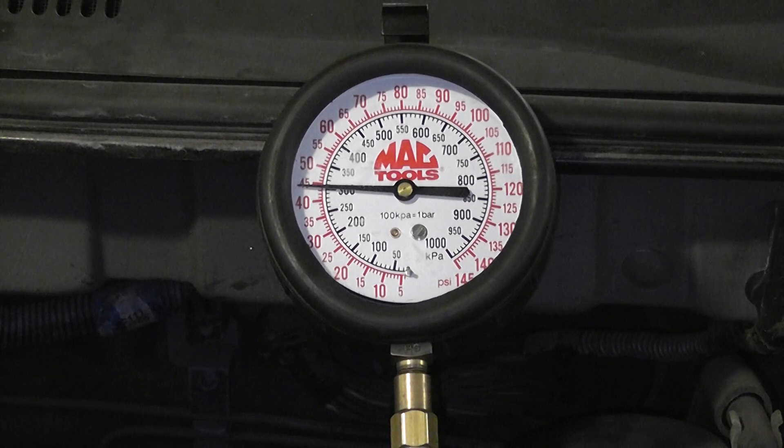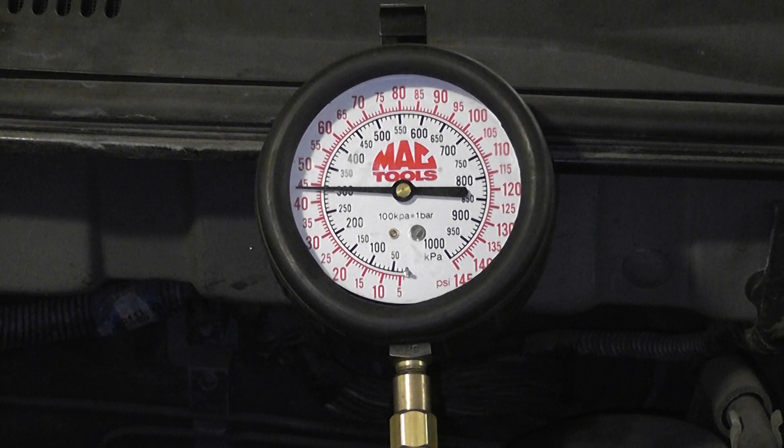47 pounds of pressure — remember that number. What's also important is that pressure holds. If pressure does not hold on shutdown, we're going to have an issue because when we put our pressurized cleaner on the fuel rail, it'll dump back to the tank. We don't want it in the tank — we want to run the car on this stuff. If you have a bleed-down problem, we'll have to follow bleed-down procedures: pinch off different hoses, disconnect them, and keep the fuel from running back to the tank.